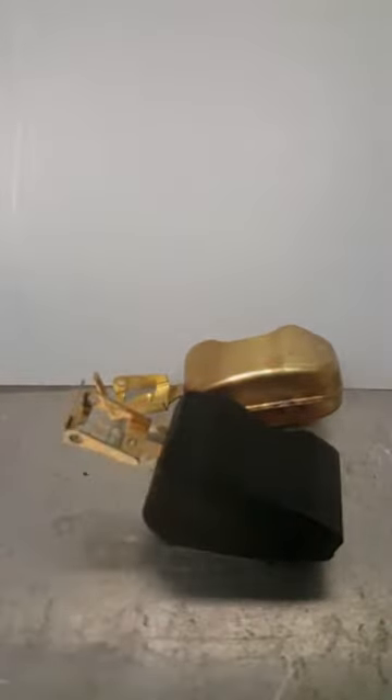The times we're going to use the composite float — as silly as it sounds — the number one reason is you can't overnight via air freight the brass floats, because the pressure differential in the airplane will actually collapse the brass float. We had that happen when we were overnighting carbs for NASCAR — we'd send them and the floats would be crushed from the pressure differential. So we could only overnight carburetors with composite floats. There's also a slight difference in inertia, but the brass float actually has more buoyancy than the composite float under pressure, so we have to go back and forth between needle drop, buoyancy versus pressure, and how we're delivering the carburetor.